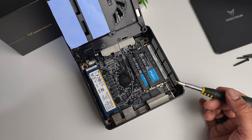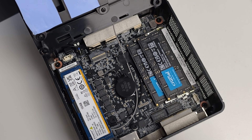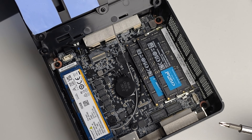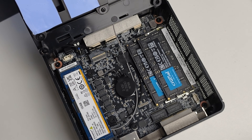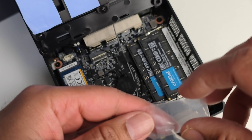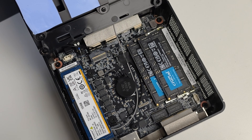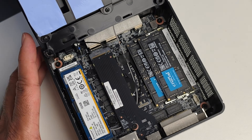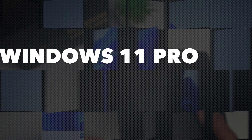Inside you can see two Crucial-branded 32GB memory sticks giving 64GB total — upgradable to 48GB per slot for 96GB total. There's a Kingston-branded 1TB M.2 NVMe SSD and a spare SSD slot. I'm going to install the OcuLink adapter in that spare slot — they give you the choice of OcuLink or an extra SSD. After seating and screwing it in, we now have a functional OcuLink port.